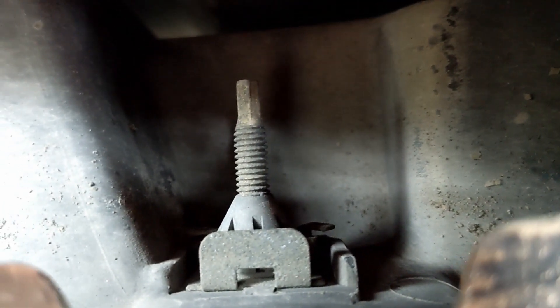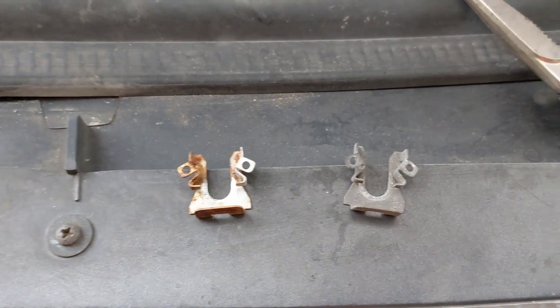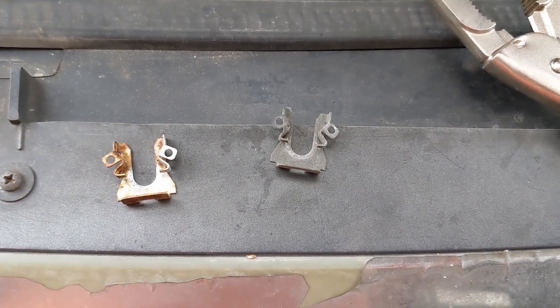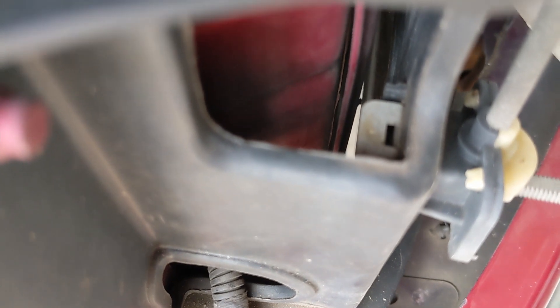With a little help of a long screwdriver we should be able to lift those upwards, disconnecting the two upper mounting points. In the end I found a pair of long-nose vice grips worked really well — getting on two sides of the clip and just continued to pull, moving side to side. It took a little bit of wiggling but they popped out. Having removed the top two, the headlight is quite loose. The third clip is a little more tricky to get to; I think I'm going to approach it from under the hood.